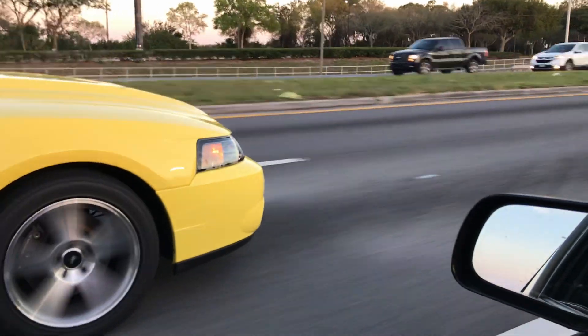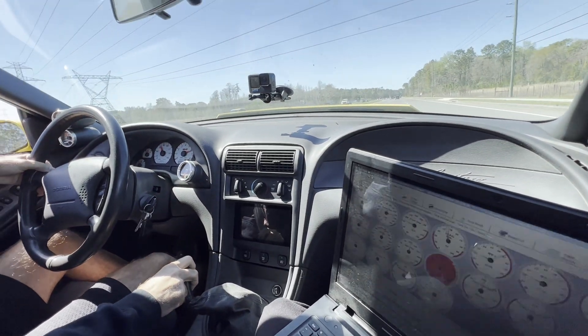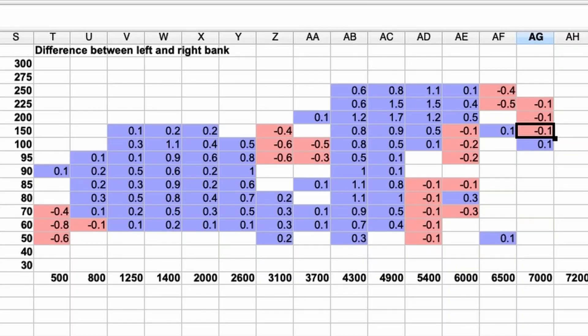As a sanity check of what something like this probably should look like, I grabbed a random log from my own car — a sixty-minute log from warm-up to ripping around and having fun. I ran it through the same process, put it in the spreadsheet, and got the differences. Take a look: this is over an hour's worth of driving, and the differences from left to right bank — the bulk of it is all less than 1%. A few cells show zero discrepancy — they're identical. Up here I see a little bit, but it's still less than 2%.